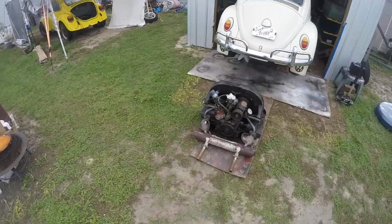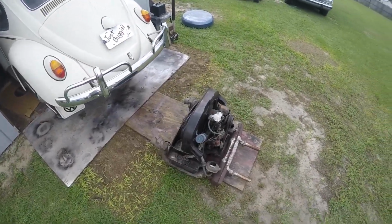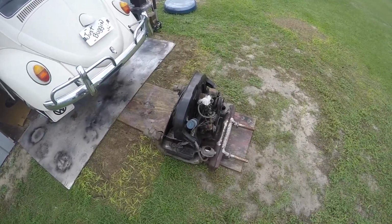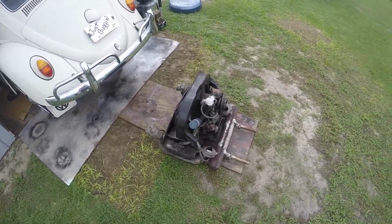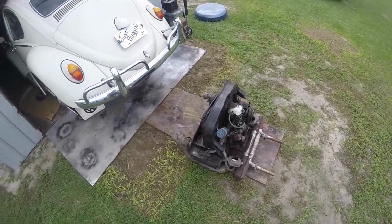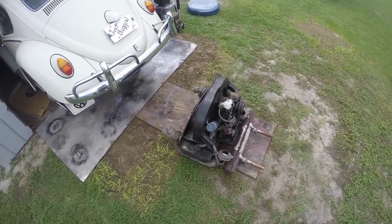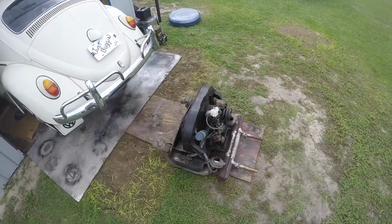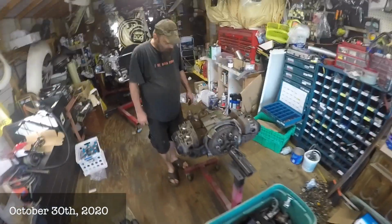Hey guys, the 65 is out. Here's the motor. We're gonna pick it up and put it on a stand and get it broken down and evaluate it and see what we have to do, and hopefully it's just somewhat of a refresh instead of a complete overhaul, is what I'm expecting. I mean, we have 1 cylinder at 100, so possibly everything's fine. Go in there, replace some of the rings and hone out the cylinders. That's what I'm expecting, but that's up to Rick. So we'll see what we got going today, Rick.